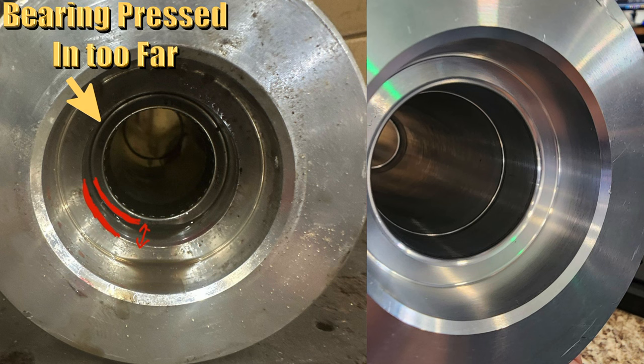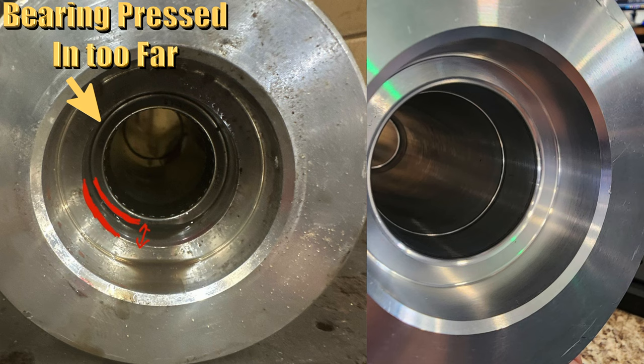I'll give you guys a quick update on what happened during this install. Unfortunately, when the initial install took place, the shop we used pushed the outer bearing in too far. With the Bronc Buster tube, the inner bearing is already pressed in. The stock tube has both inner and outer bearings already in, with the inner bearing pushed in from the inside. With the Bronc Buster tube, they send you the outer bearing separately — which is a circle bearing — and you push it in on the outside. There's a small groove on the very end of the tube, about an inch in, and that's where the bearing is supposed to sit flush against the outer edge of the differential tube. With it being pressed in too far, it constricted that bearing and made it smaller.